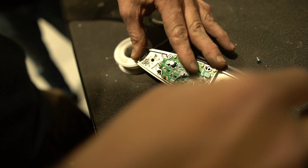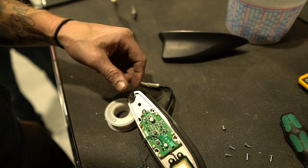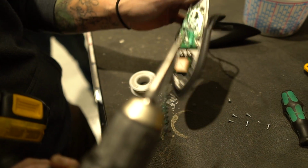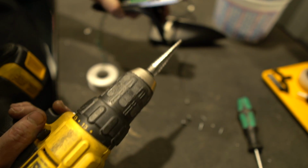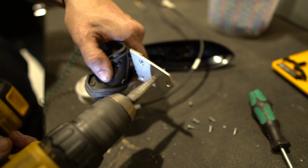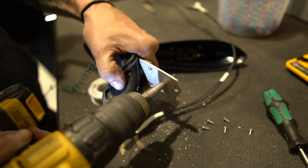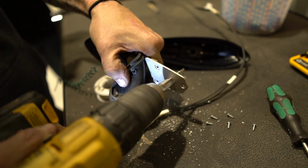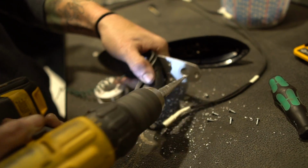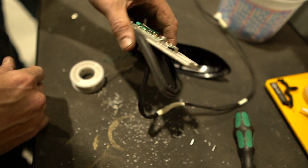And it's a super soft metal, man. It's not a difficult thing to drill a hole in at all. So we're good there. We use a Unibit Harbor Freight, right, to expand this hole, and because this one's going to throw away more chips, we drill this one from the back. Okay. And we just run that all the way through until it goes through the base. It'll be a 1/2 inch hole. It's a Unibit. They call it a step bit, same thing. But that way none of the contaminant dropped up into here.